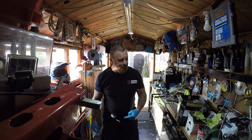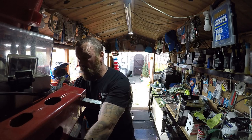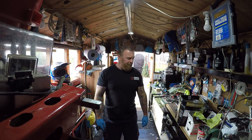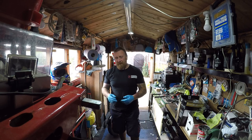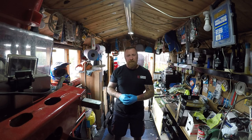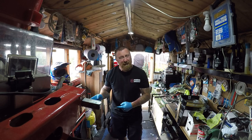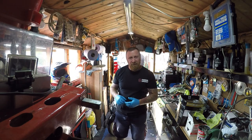Now why is this back in my shed? Well, I actually sold it and I was very happy — it did all the things I thought it should do: it started, it stopped, it rode up and down the road. The guy who bought it is an older guy, and he contacted me saying it was really slow. What I think happened is the rollers — if you leave a bike for months and months the rollers can settle, they weren't opening up. He needed new rollers, so I simply went over there. But this little GY6 engine — it's a Peugeot V-Click, same as the Vogue and all these general shaped bikes — same engine.